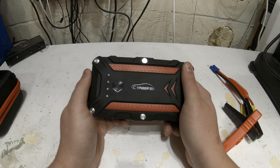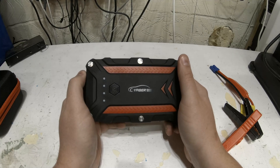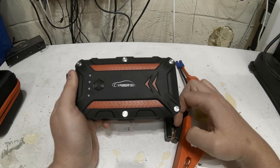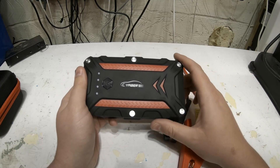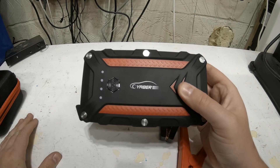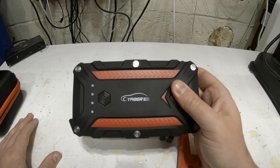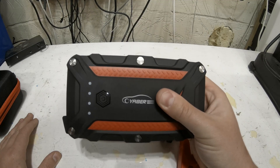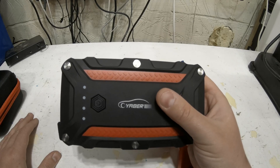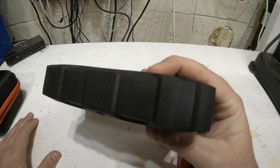I've used this on my Honda S2000 just to start it to test the device. I've also tried it on diesels and it does struggle there, because if the battery is particularly depleted, the glow plugs will just kill it — just flatten it straight away. This hasn't got a huge battery; it's designed to put out a huge amount of amps but with very little capacity. With some diesel engines I've had to connect it, let it discharge into the diesel battery, then recharge it and do the same again. That's obviously inconvenient, but if you're desperate it will get you out of a bind. There's lots of information about these online and to be honest they're pretty good.